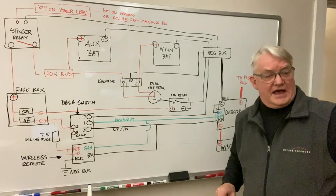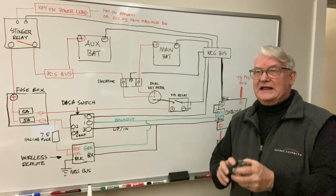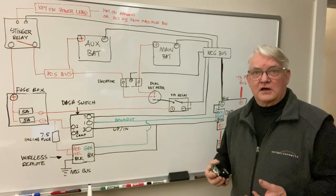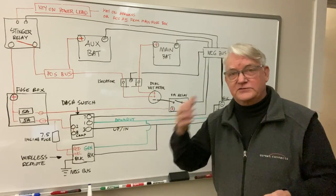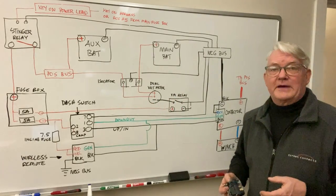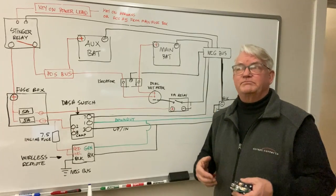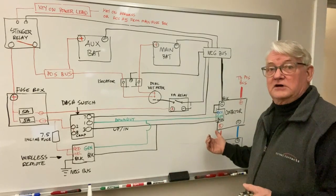The contactor is like a relay — a low-current, low-power circuit which then energizes a higher current, higher power circuit that you don't want at your fingertips. The relay is protecting you from that high current surge, and we don't have to run heavy cable up to the dashboard. A relay is generally good for about 10 to 20 amps maximum at 250 volts. A contactor is good for over 10 to 20 amps and up to 1,000 volts, and has additional safety features like arc suppression. It's very good for controlling motors, and the winch does have a motor in it.